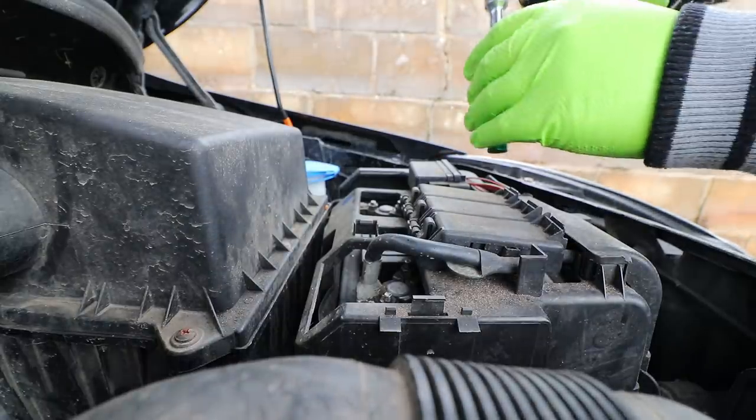There's a pretty nasty grinding noise. There are actually a few people who said they've had the same issue on different cars but with the same gearbox, and theirs ended up being the bearings inside the gearbox as well. So I'm pretty certain that's what it is — I'm excited to get it fixed. First things first, I'm going to start with the battery.